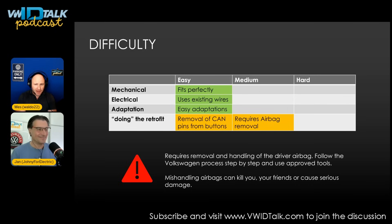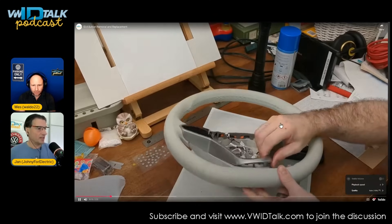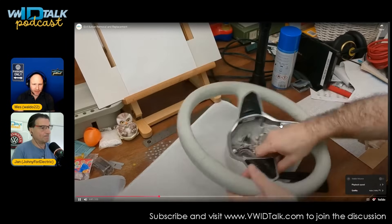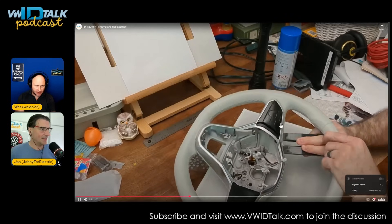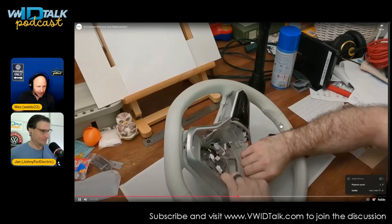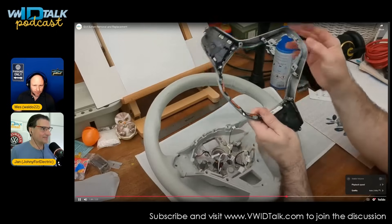This can be done — that's the good news — and it makes me very happy. Next we have a video of me showing how to pull out the trim, because the physical buttons have a different shape of trim. You can't just replace the buttons; you have to replace the buttons and the silver trim. You do not have to remove your steering wheel from the car — I only did that to show it better on video. Just apply firm and even pressure. I started with the bottom, using a little trim removal tool to gently pry it up.